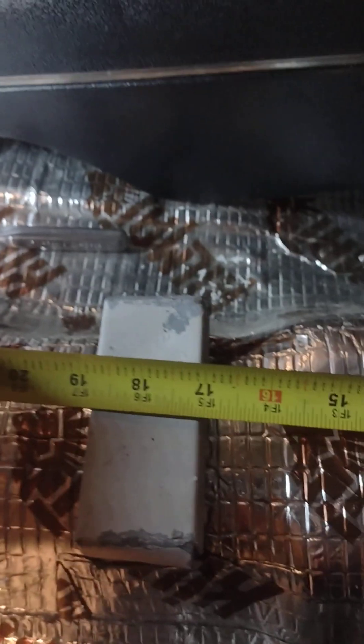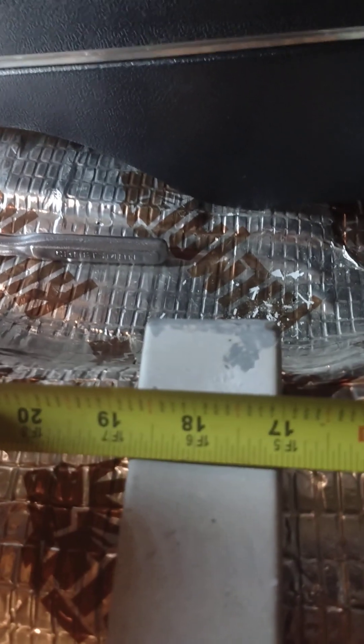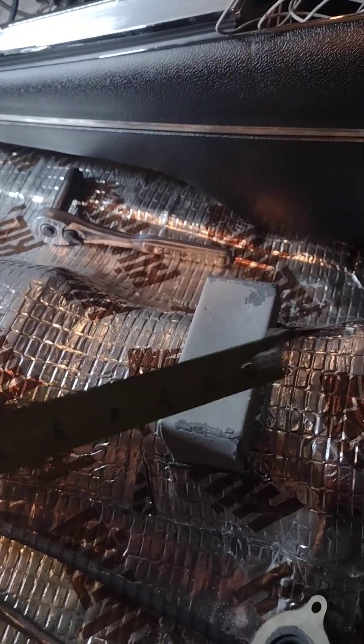For the bracket position, going from where the back seat is, forward to the edge of it — taking it flush at the bottom, down as far as it'll go against the back edge — it is 17 and an eighth inches forward to this edge right here. So from the back seat edge to that point is 17 and an eighth inches forward, and then you can weld that down.